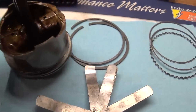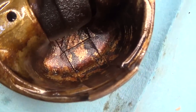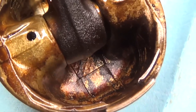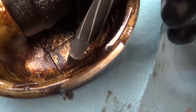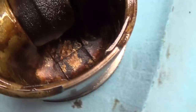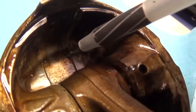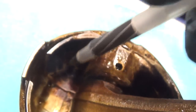The other issue is if we look inside, you can see there are supposed to be four little holes to help lubricate that oil control ring. There's one right here, two, three, and four — they look really, really clogged up in there. Now this side looks a little cleaner: there's one, two, three, and four is in the shadows right in there.